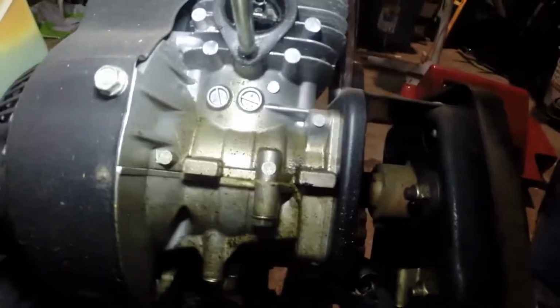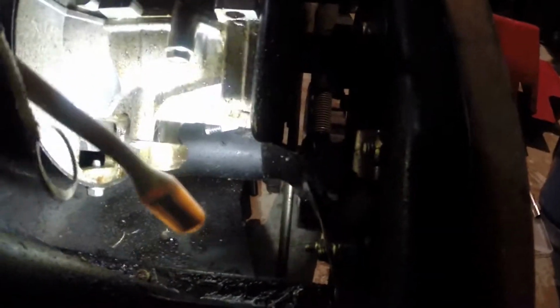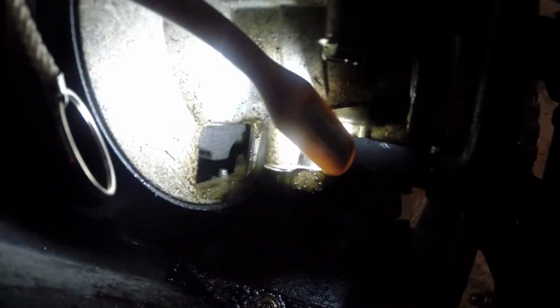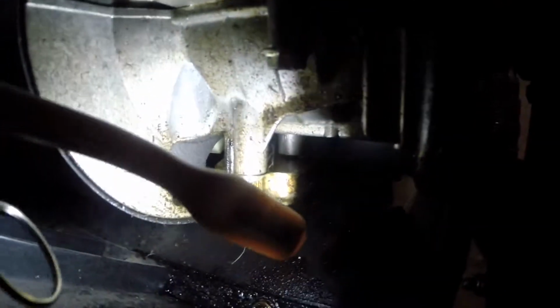That's just gonna make for a real messy cleanup every season, right? And if you got this electronic device sitting down there and all that gunk, and the potting ain't so great down in there, you're gonna get oil and all that kind of stuff in this guy, which might be that ignition unit that always fails. Maybe? Or am I crazy?